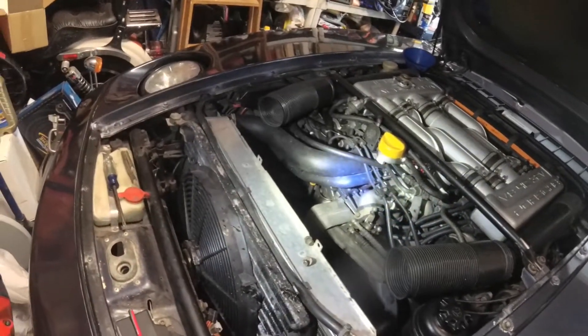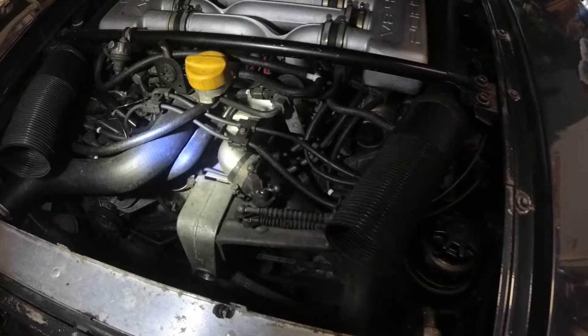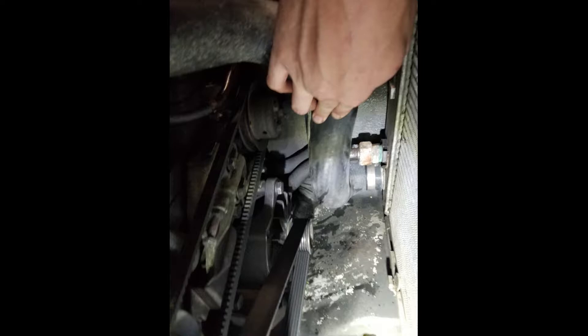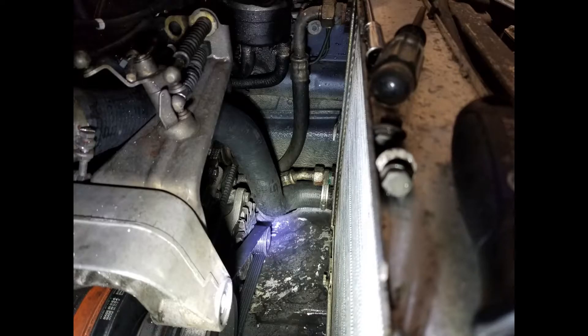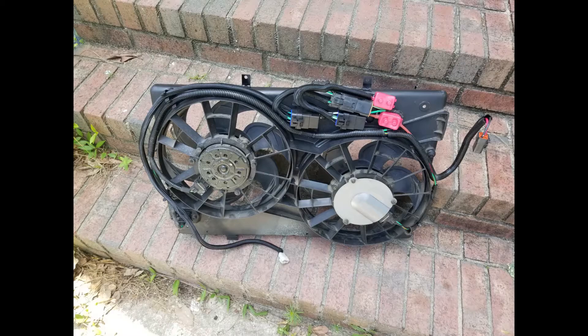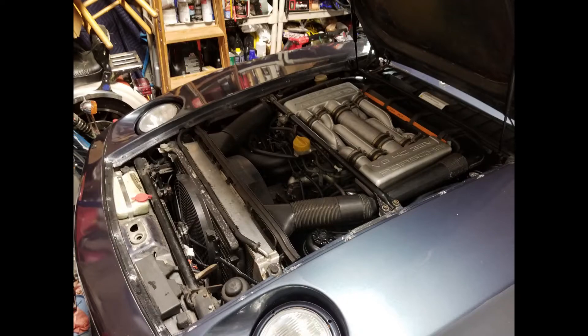This is where I was planning to tell you about how great it worked on a test drive — which it did — up until the point where the lower radiator hose was pushed outward by the fan and rubbed the alternator pulley, putting a hole in it. The radiator hose sits pretty close to the alternator pulley as-is, and I forgot to tie it out of the way like the original shroud did. It turns out the S4 radiator hose fits really well there, and since the S4 has electric fans, it was probably routed differently. With the fan back out I cleaned up the wiring a bit — mounted the relays and circuit breakers more neatly, made tabs to hold the top of the fan, and with the air dam piece from the original shroud it all looks pretty tidy.